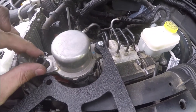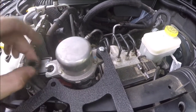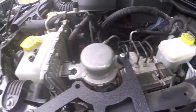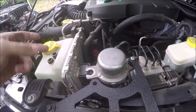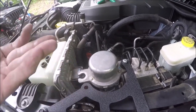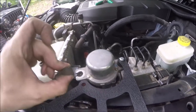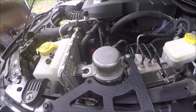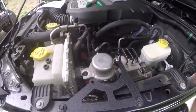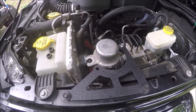I cut off a section for the bottom as well. The bolts will go through this hole, through these pieces of rubber and that bracket. Then all I need to do is find a washer that will go on the bottom so that when I start tightening it up, it will squish these a little bit and create a rubber isolator. I am going to order a proper one, but I've got to get it done today — I don't have a way to go get one right now. I'm not going to tighten that up yet until I lengthen these lines.